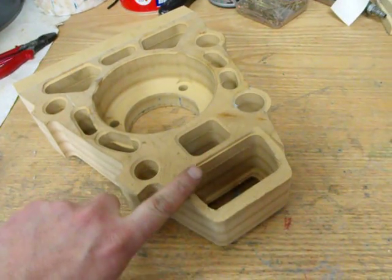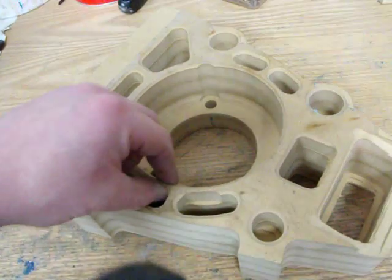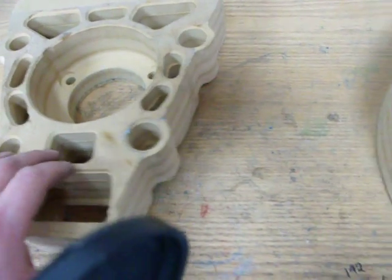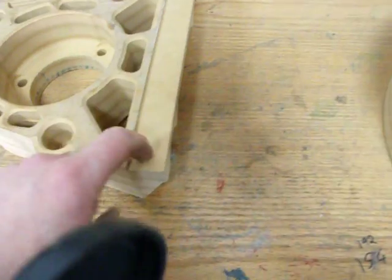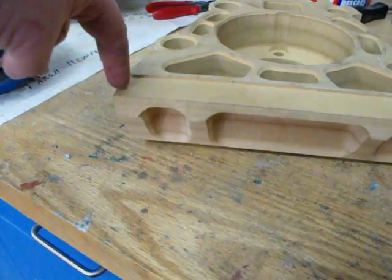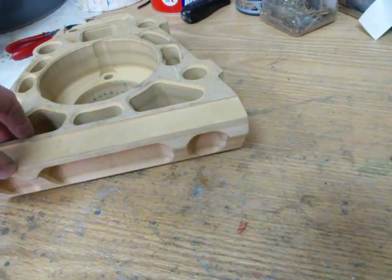Just a little more machining needed to clean this face up here — this is tapered down. You can see a few minor pieces here where I thought it was too thin, so I changed the program and brought it out slightly. A few things — obviously MDF looks a bit dirty, but technically it's in the flesh now. Next op would be to drill; if you look from here you can see the web, so you can drill into here, here, here and here, and that will be the mounting bracket which will come out before we fit and mount the top wishbone.